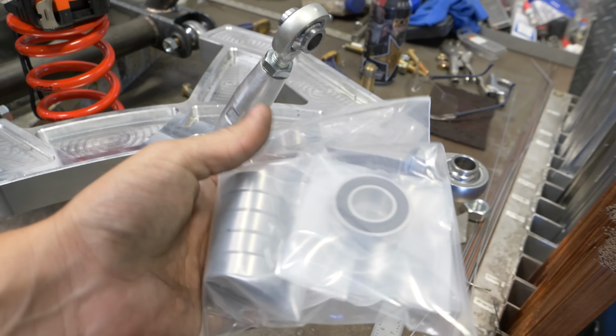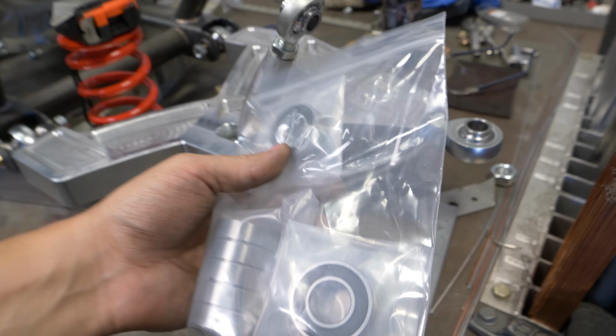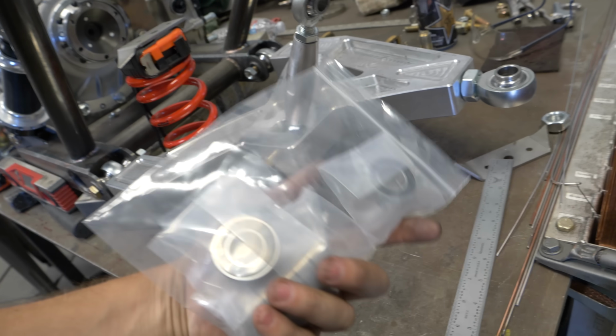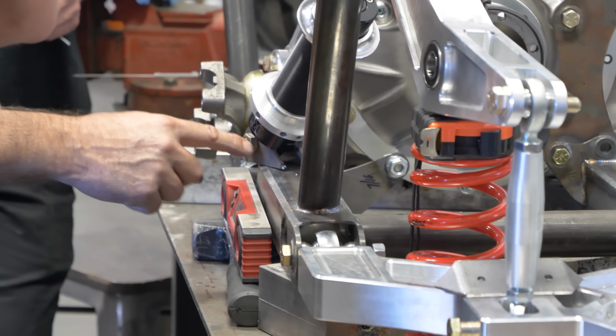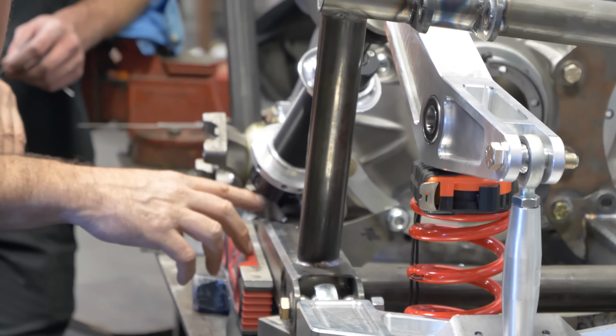We're also just fine-tuning the shit out of the rear cantilever system because it is a very, very tight fit. So we found when it articulated with the shock the other way, it would crash the shock into the cantilever, but then you have to be careful that the cantilever doesn't crash into the upper control arm or the other tube frames. It's just a very particular narrow window for that to work. They're BMX bike bearings. That's a lot of alliteration. This has to radius around because when this thing goes the other way, it's going to go down.